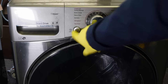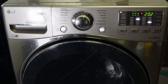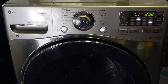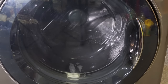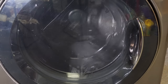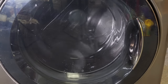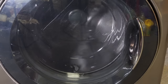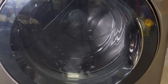When you're ready to go, put the washing machine in either a sanitize or tub cleaning cycle and run the full unit. I realized in the video I used the wrong mode like a sanitize cycle, and I had to stop and correct that off screen when I found the actual tub clean cycle. You want to let the unit wash through the entire cycle. Be warned if you want to pause the machine and open the door during this stage — the water is going to be extremely hot because of the reaction between the concentrated chlorine in the pool shock and the washing machine water. So again, be very, very careful. It got pretty steamy when we opened the door off camera.